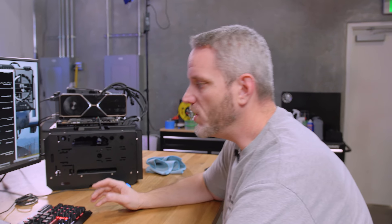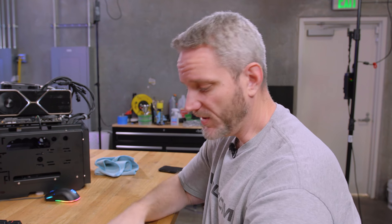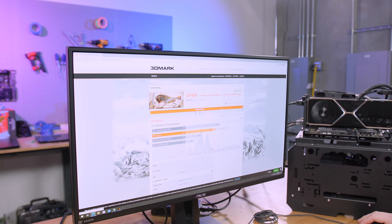These cards are very power limited. When you max out the fan, that's a few watts not available to the core. So when you're power limited, cranking fans to get core clock higher works in theory, but five extra watts can do a lot for maintaining clock speed versus having fans at maximum speed. That's why we get creative with the AC — it means we can leave fans low, keep that wattage available to the GPU, and get maybe an extra 30 MHz of sustained clock speed.